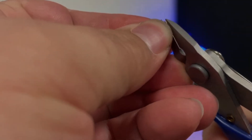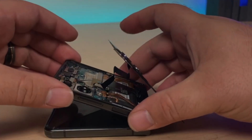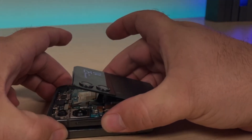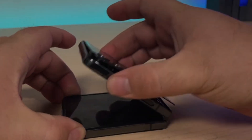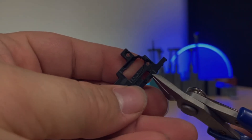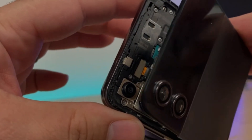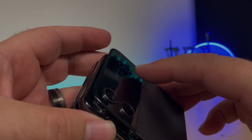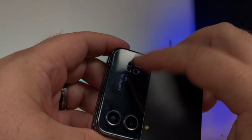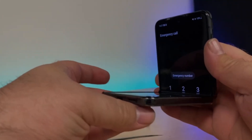For older hybrid devices like the Flip 1-4 and the Fold 1-3, mechanical adjustment is your first line of defense. Carefully examine the hinge magnets. On the Flip 4, for example, moving the magnet just 0.3 to 0.6 millimeters can restore proper detection - re-gluing or reseating it often brings it back to life, as demonstrated in a previous video on the Flip 4. By adding small magnets or physically moving the existing one, you find the sweet spot where it was previously calibrated. However, what works on a Flip 4 won't work on a Flip 5 or Fold 6 - the IC logic ignores the analog field completely, so digging into those frames to find the magnets isn't going to be the solution.